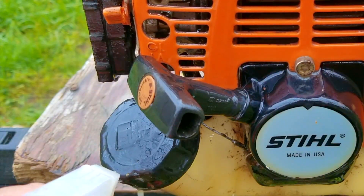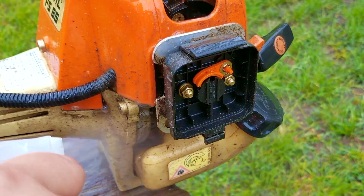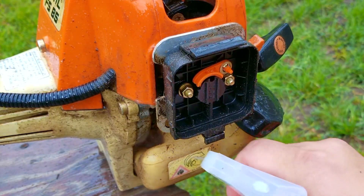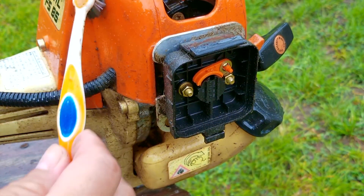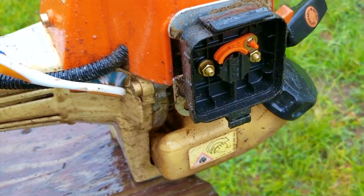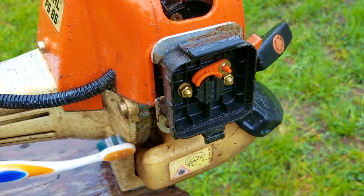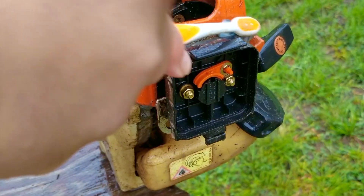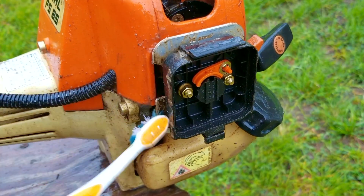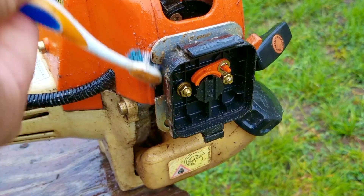This trimmer was missing the air filter cover when I got it, so as part of the repair I had to replace it — and luckily it wasn't very expensive. I also had to replace the air filter, and combined it was under $20 shipped to my door for both. If I was using water to wash away the dirt, I would put a plug into the air inlet on the carb or wrap the entire filter base in a plastic bag. The water shouldn't get into the carb unless you turned it over to the muffler side, but as long as it's sitting normally it should be okay.